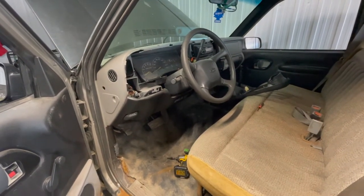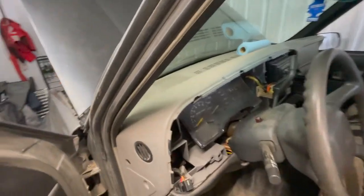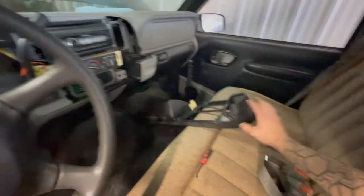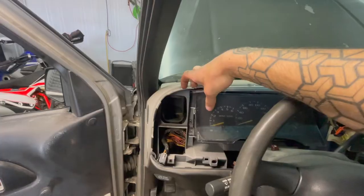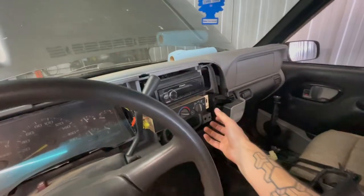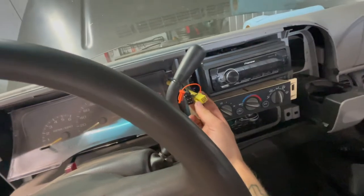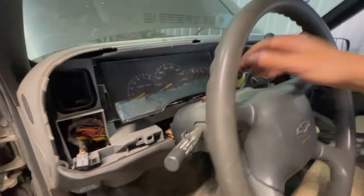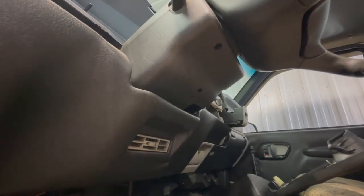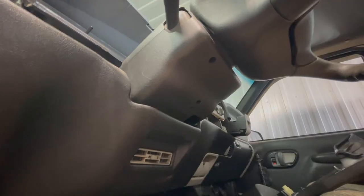Pretty much the first step I'm taking is removing and doing all the work inside the vehicle and then later working my way underneath. So first thing I did was take this bezel - the front dash piece - off. You just get your hand in here and pull all the way around and it comes off. You have to undo the main connector for the light switch, as well as the airbag cutoff and dome light. After that we remove the bezel around the steering wheel. Underneath there are two T25 Torx screws, so we're going to remove those now.